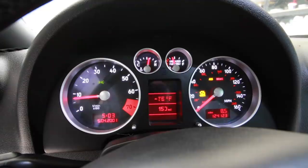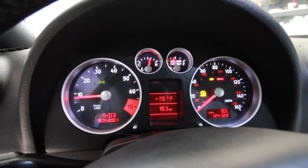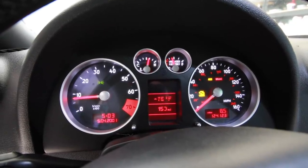Another thing I don't understand, and maybe it's because it's in limp mode because the check engine light is on right now, but it's kind of cycling on and off. Like the RPMs come up to like 1,000, then drop back down to like 600, then they go up to 1,000, and it keeps going up, down, up, down. And when it's doing that, it's cycling the cooling fan on, off, on, off. And I think that's why I'm also having trouble getting it to normalize at idle if I don't have the HVAC turned on, so I have the coolant going through the heater core.